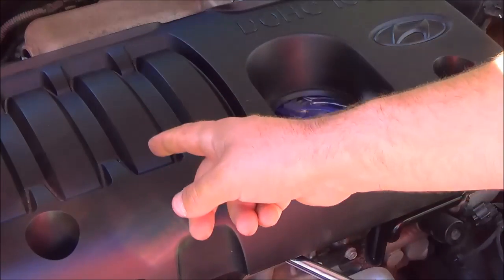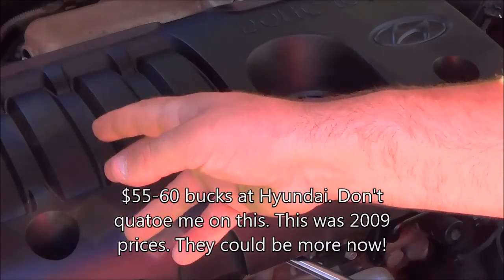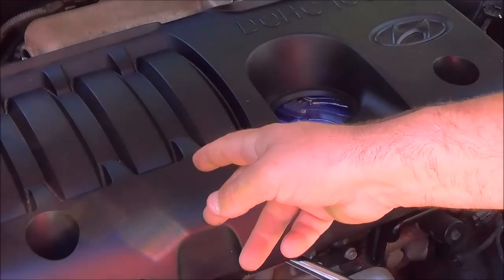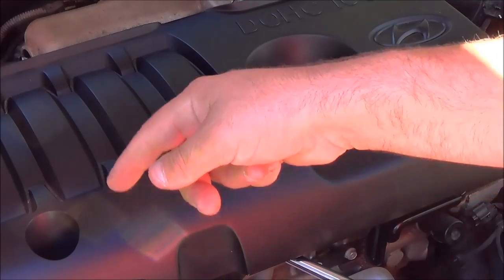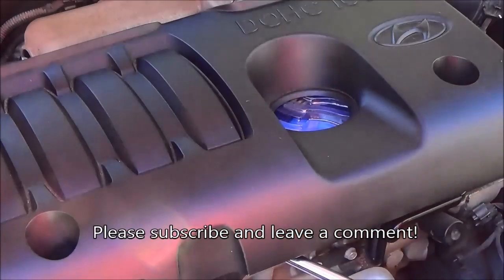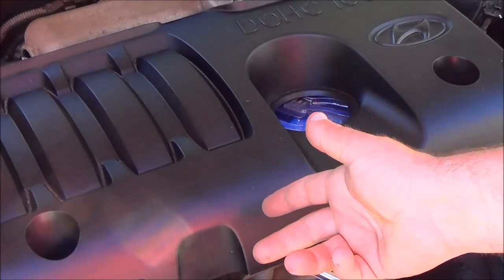The service cost is 55 to 60 bucks at your local Hyundai dealership. Hyundai suggests you replace your spark plugs every 48,000 kilometers or two years. If you use NGK spark plugs, you can go 96,000 kilometers before you need to replace them. Every second year I replace them with new ones — it's up to you how you do this, but this is Hyundai's recommended service interval for this car. Anyway, thank you for watching this video. Please subscribe, leave a comment, and look for more videos to come in the future. Have a good day.